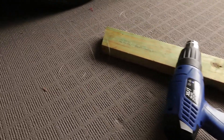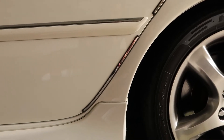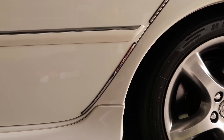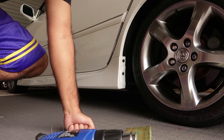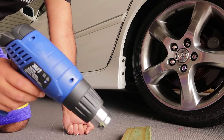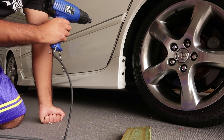What I've got is just a heat gun and some fishing line, hoping that this will let me remove it without damaging the actual chrome strips. I don't want to pull back on the chrome strip just in case the paint doesn't match and I need to put it back on. I'll just heat it up very slightly — I don't want to heat it up too much in case the paint melts.